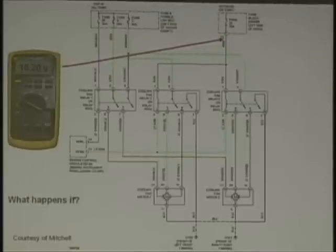Now, like I said, you did say we have a voltage drop. And if we're measuring right at this point, that voltage drop is probably where? The fuse or the connectors. Exactly, very good. Now, by the way, we're assuming that the car is charging at the correct voltage here. Write that down. That's why you think of these things if you come across this problem. Now, how is it going to affect this at all?